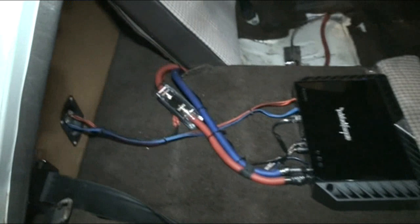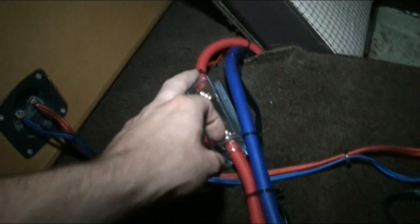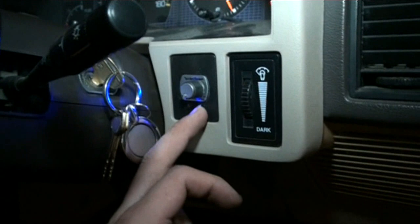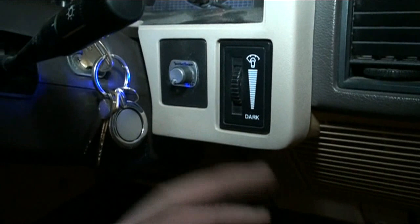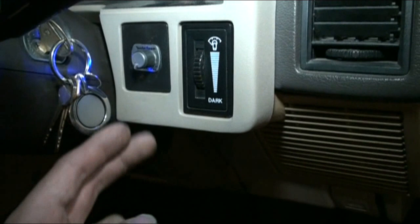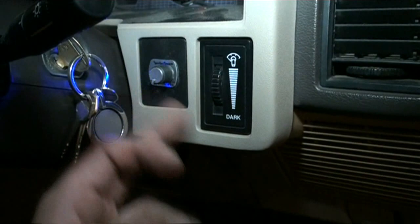Finally we're done. I've got it hooked up — that's the bass knob there, hooked up. I've got the power for the voltmeter going into the fuse there. I would have put it into the amp, but with these zero gauge things I'm not going to do that. I'm going to put the seat back in there — besides that, she's done. Now I have to re-DD1 it because I had my punch EQ on zero. What this does is when it's on full it activates the punch EQ. So when I was turning it up full, I had my gain set and was turning the bass up — that's terrible distortion. So what I've done is turned the gain down and reset it. Now the gain's on about a third compared to about 70% before. The difference is when this is fully up, it's still clean. And when this is fully down, the bass is pretty much off.